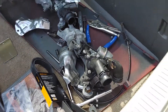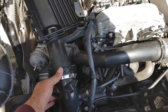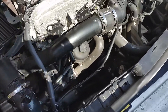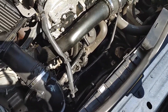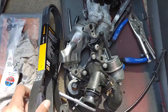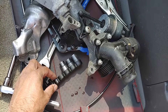Other than that, everything's pretty straightforward. I found it hard to separate these two pieces because they're both hard plastic and wouldn't come apart, so I just left them in place. Take apart all the coolant hoses that are in the way in the front of the engine, get them out of your way, take out the air box, and then there are three e-torx bolts holding the water pump in place. I ended up using the E8 e-torx socket for the water pump heat shield.